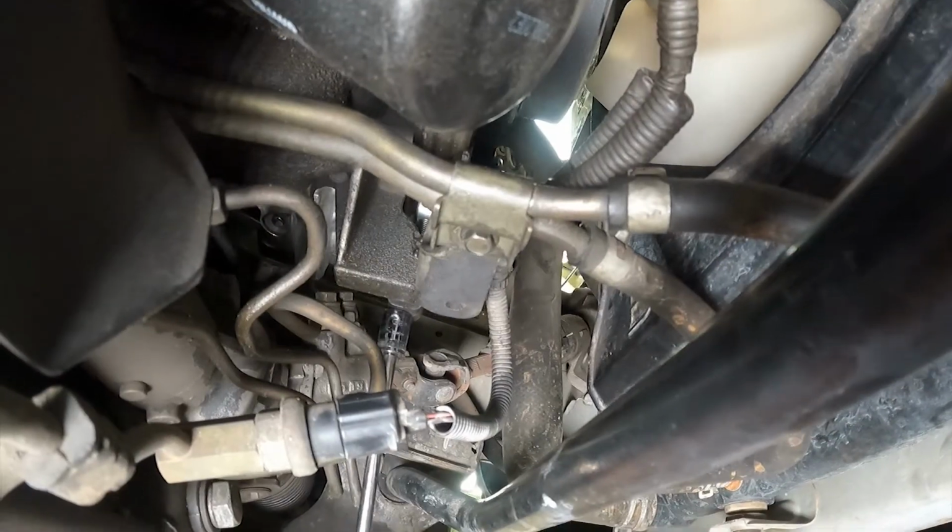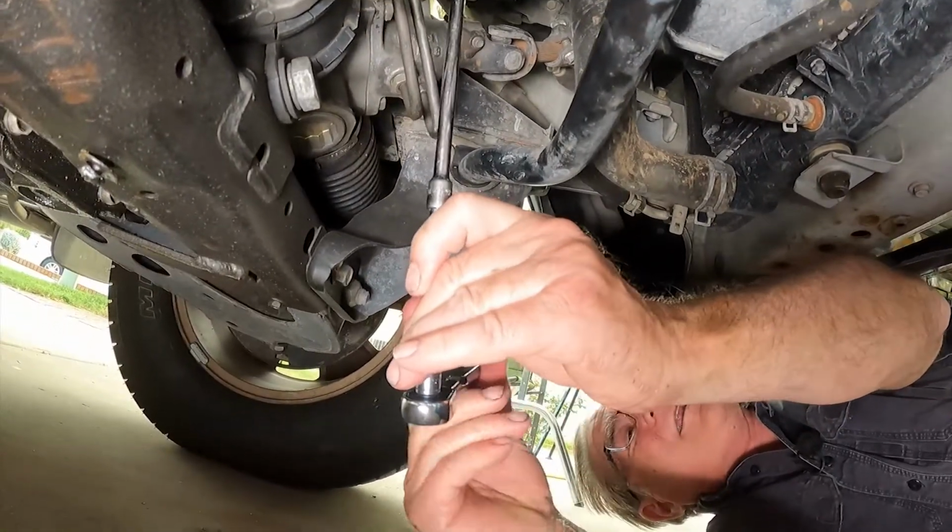Again, this is one of those things that can be helpful on many cars. Now, just as a caution, or just as a piece of information, many cars, especially American cars, will have a spring tensioner. A lot of foreign cars will have an idler that you have to manually adjust, and it'll have some kind of an adjustment screw or a method of rocking it and tightening a bolt to get it tensioned properly. Now, this particular one that we have from Nissan has a tensioner screw to put the tension on the belt. So we've got to loosen the screw, and then we've got to take off a complete bracket. But we'll show you how that goes.